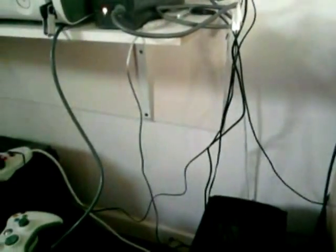To set these up: you have your Xbox power plugged in and all that, just set up your Xbox as normal, but take the video cables and plug them into the back of your HD PVR. That's what you do, but you leave your audio cables out. Then what you do is take your cable from your headset down into the cable splitter.